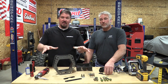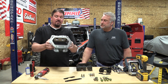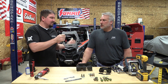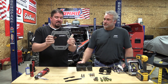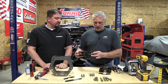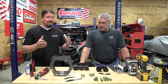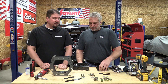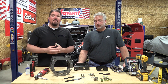We've got everything that we need and we've kind of put it out on the table. They give you a nice front brace with their Assault Racing logo, which gets bolted onto the front gusset of the machine — it creates the gusset of the front bulkhead and takes six bolts. Then there's the upper rear control arm brace, double shear, and the lower rear control arm. Everything gives you a double shear joint and the metal is almost an eighth inch thick, true eighth inch, versus the paper-thin stamped metal from the factory. A lot stronger, plus you're getting the double shear. If you've got a Can-Am, this is definitely something you want to look at.